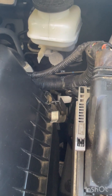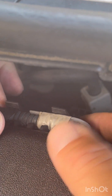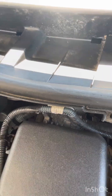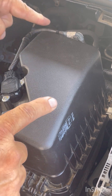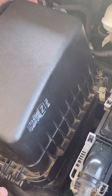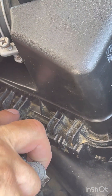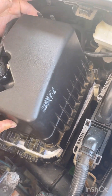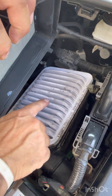The last piece is taking this wire harness off the clip on the back — it's just a snap. With the clips removed, we can now remove the cover of the box. To do that, we tilt the back up ever so slightly because these two points right here are actually hinges. We rotate it up and then slide it back off the hinges, and now the cover comes away.